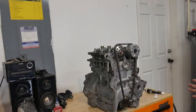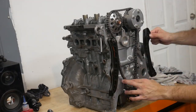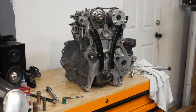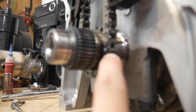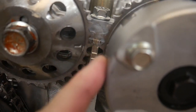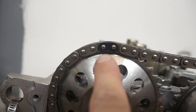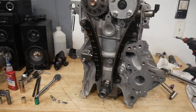Let me show you guys the timing marks on this. That blue mark should be dead center of that chain length — that's the timing mark. Then we'll have one at the top that correlates to the vertical timing mark, and we need one on the side facing in. We've got one facing in here and one facing the top length, so these lengths also match up. That is how you time the 3A92.